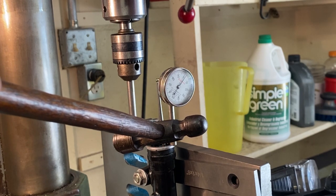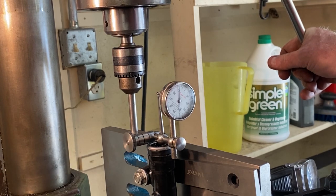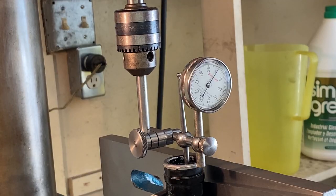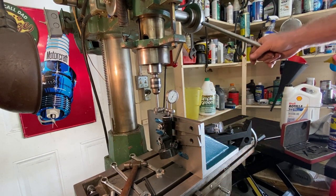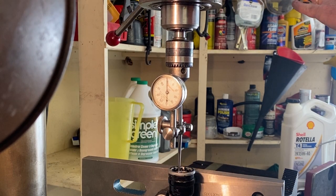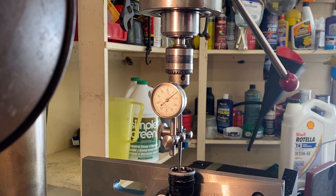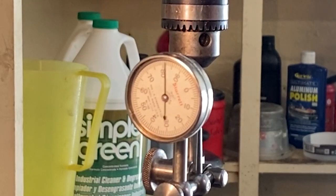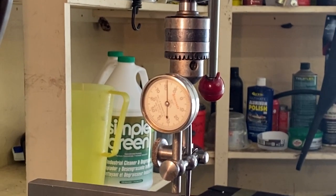If the top is high, the bottom is low — get over that. There's not a whole lot of travel to test it but that's all we have, and there are some variances inside that bore too. Now we're 90 degrees turned, measuring to see if it's parallel with the angle plate — and that's pretty damn good. I figured they used those mounting surfaces as a datum, probably machined those first, then fixtured it and bored it in some sort of horizontal boring machine.